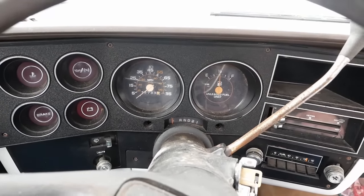There's about a zillion different choke options for these Quadrajets. I have no idea what the difference is between them all. Anyway, according to the Standard Motor Products catalog, the correct choke for our carburetor part number is inside this ridiculously large box. It's a CV383. And there it is.